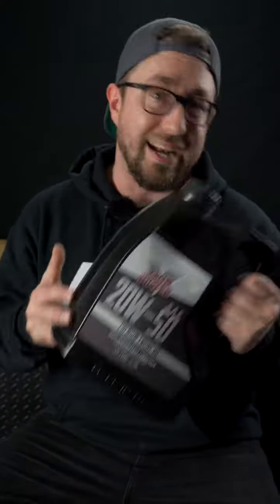One of the biggest reasons why we love this kit is it's got everything you need in one box. It's got a gallon of oil, it's got an oil filter, it's even got a bottle of semi-synthetic transmission fluid, and it comes with a quart of primary lubricant — two things that you typically forget about when doing your annual oil change.